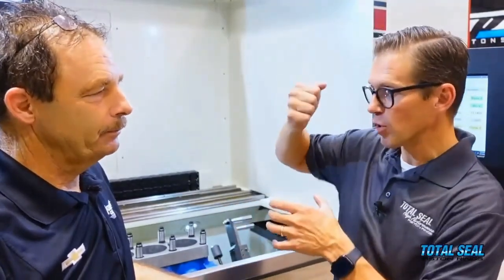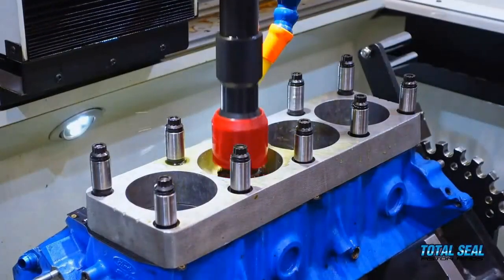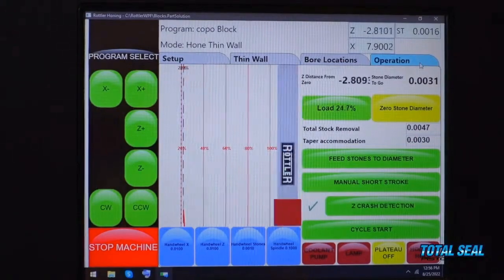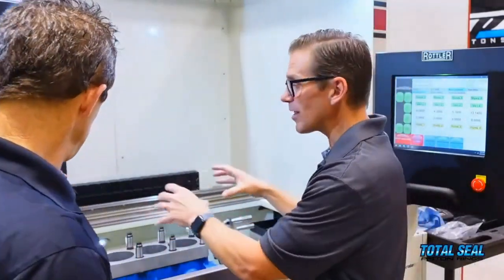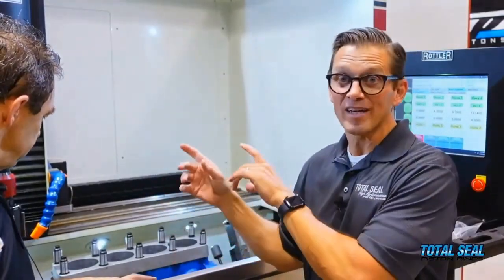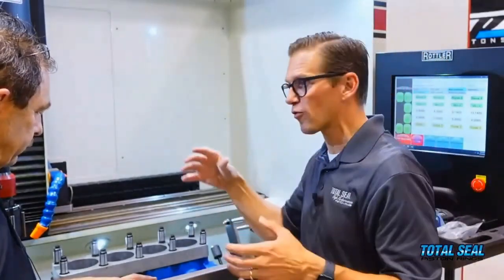Step three: as opposed to progressive stepping, you go to size with the roughing abrasive, then it's not stock removal — it's counting the number of strokes in plateau mode to create that extreme plateau. In the old days, we'd use 320 grit to go to size, then finish with 400, but it was so smooth you couldn't hold enough oil. Old molly-based rings were porous and held the oil themselves. But today's rings have a very hard coating, very flat surface — there's nowhere for oil to hold in the ring. You have to hold it in the block.